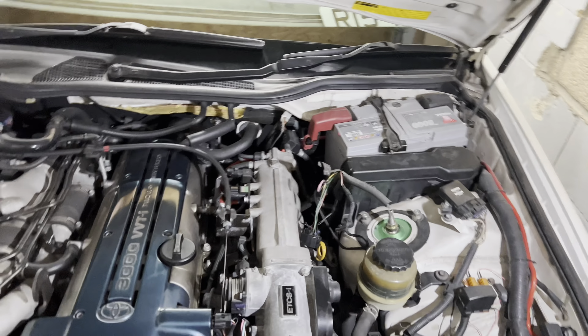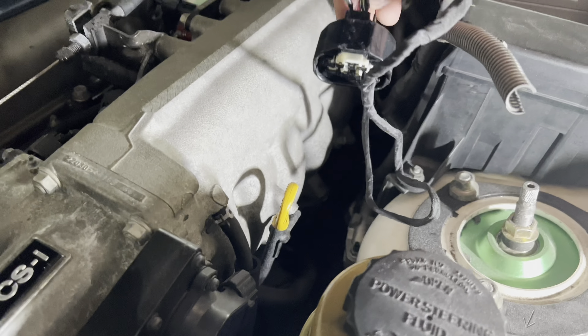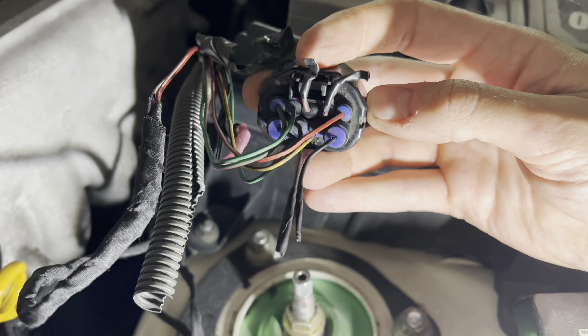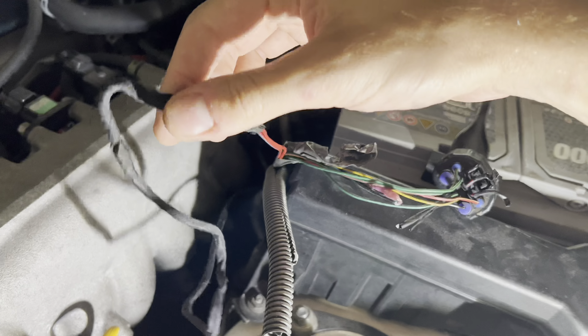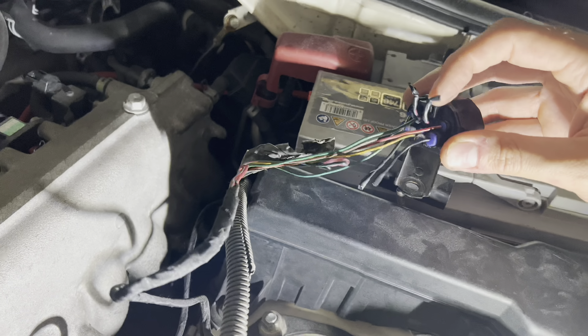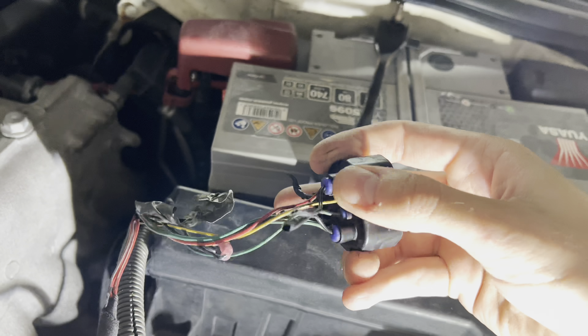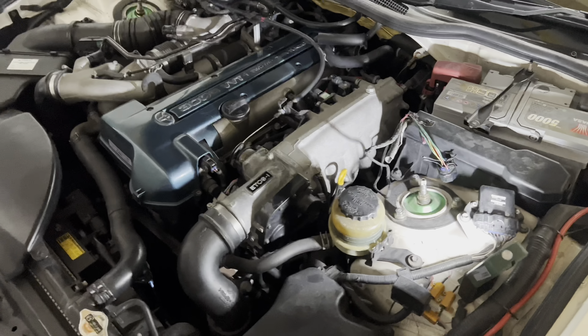All right, let's take a look at this wiring. This seems to be where the biggest amount of confusion comes from on the conversion. The wiring is actually really straightforward — I've done a bit of prep here for you. On the main gearbox connector, these two pins here are the ones you need for your reverse light wires. We've just cut them off and joined them further down the harness to neaten things up. And then, as discussed in one of the previous videos, the two large ones you just need to bridge for the starter motor — and that's this here. Super easy on the wiring front; any questions, just drop them in the comments.